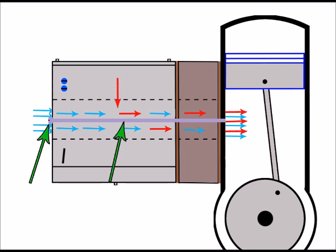combustion. Now, one problem that can arise is when this bolt here, the retaining bolt, is loose. Everything's okay at the moment because it's tight. It's holding the carburetor and the manifold onto the engine, and it's keeping those two gaskets in the middle there airtight. It's allowing them to be airtight.